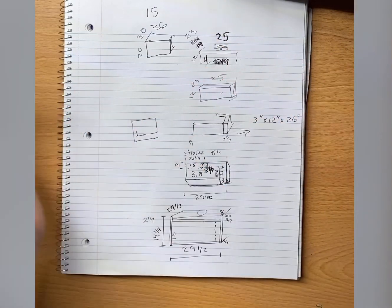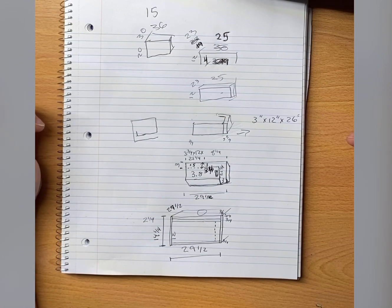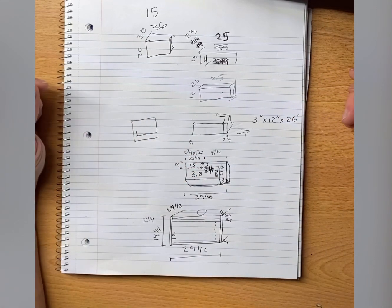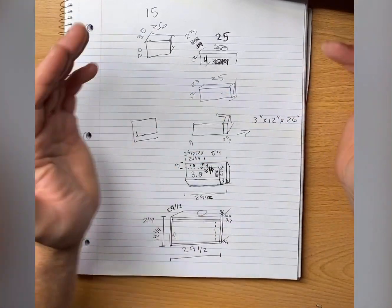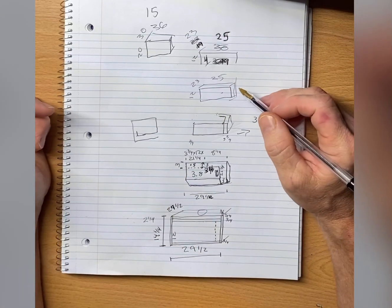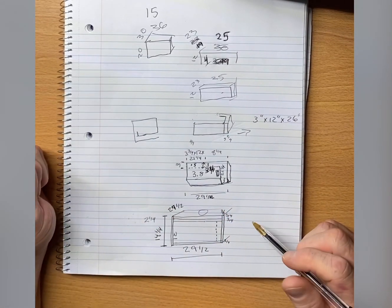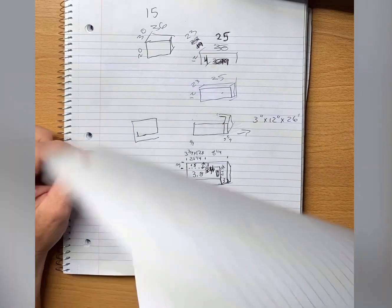I did a post one time, one piece of 3/4 plywood is 2 cubes. Obviously you're not going to have that much, but that shows the displacement of a 3/4 piece of plywood. So if you go filling this up full of plywood, you're just taking away from your airspace. So you've got to think of wrapping that with plywood and then adding a port to it, to be wrapped as well. And then you end up with a full box, and this box would do absolutely what it is intended to do.